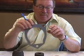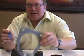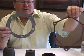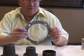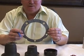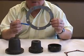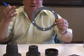With the Caterpillar or Mack gasket, it's not so much of an issue because the cavity is quite large on the front of the Cat and the Mack. But with Detroit compressors — whether the older style or newer style like on a 109-430 — the drain hole becomes an issue because it's smaller. Many techs use way too much silicone when installing this gasket. You need just enough to hold the gasket still so it doesn't move when you slide the compressor in and put your bolts in. You don't want to restrict the oil flow, or the compressor will flood with oil immediately.